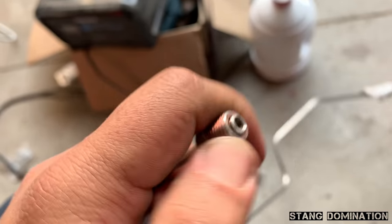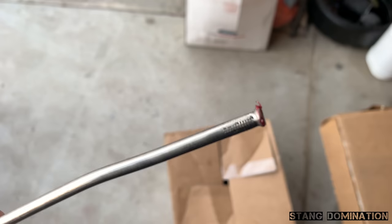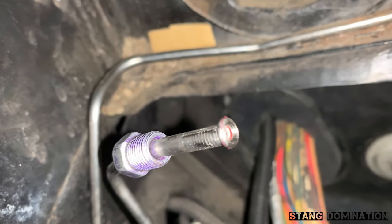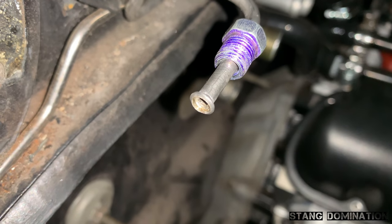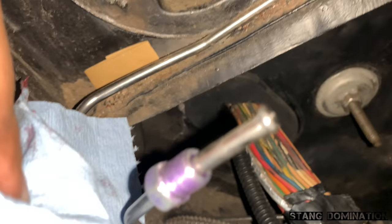I'm going to do it a few more times before I start doing it on the car, because I got to get the brake proportion valve line — the one that goes to the brake proportion valve — squared away and flared. So I'm going to give a few more practice tries to actually finish this so I can get onto the actual car. I don't want to mess anything up. Second to tenth attempt and it looks like a success. Let me just clean this off. Double flare it, baby. Bend it up, flare this and be done. It looks great, it looks stock, looks original. Let me clean all the lubricant off. Look how smooth that is — that's the one I did. Now this is the original and you see how it kind of looks like somebody pushed a not-flared circle and just punched it. That's what it looks like. But hey, 70 bucks, you can get your own tool, you can do your own brake lines.